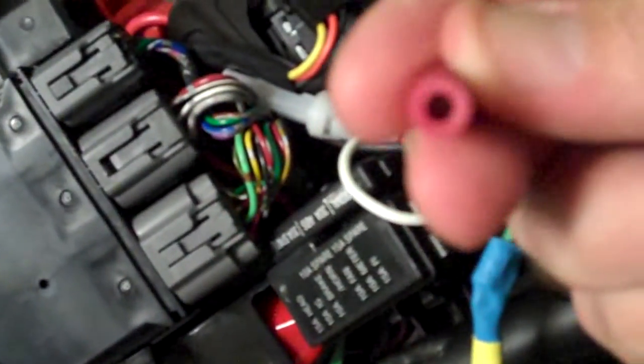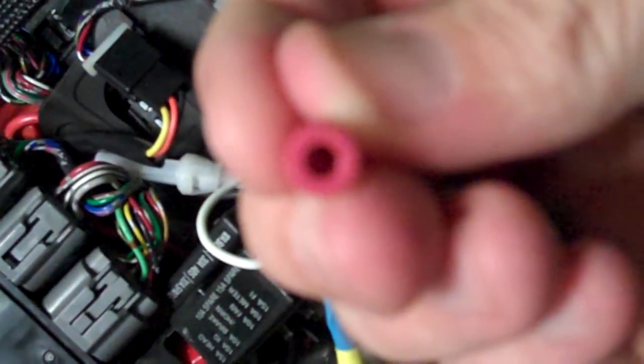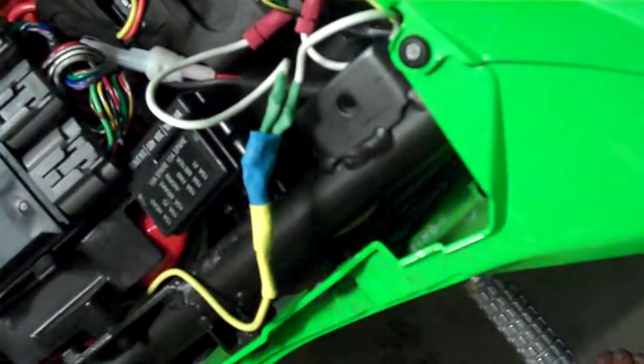The other end has got a hole. So the whole thing unscrews like this. This end screws into that hole there. There's a hole straight through there. So you feed this wire — you trim back some of this white sheath so you've got some exposed wire, put it through here, and then screw it all back together. There's a link I found on the net that shows you how to put it all together. So that's one side of it.